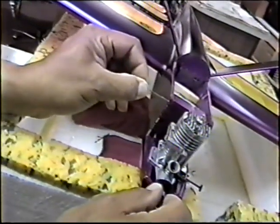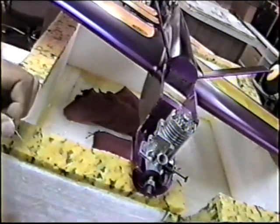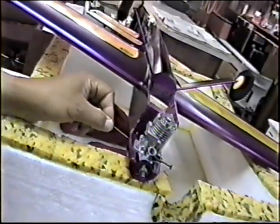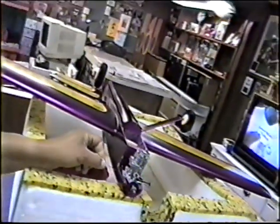Located with a pinhole, the area of choice to drill an eighth inch hole. Now you're going to have to try to get it centered right through the motor mount. Yeah, this one's going to be right through. Yeah, that'll be good.